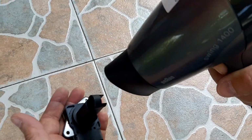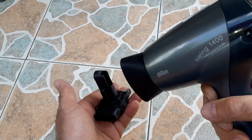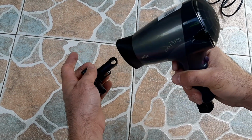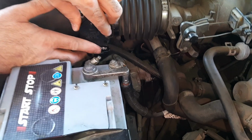After you have completed cleaning the sensor, it's better to dry it with a hair dryer. The isopropyl alcohol dries very quickly, some 3 minutes will be enough. Just don't install a wet sensor into the car. When the sensor was clean and dry, I installed it and enjoyed driving my Jag.